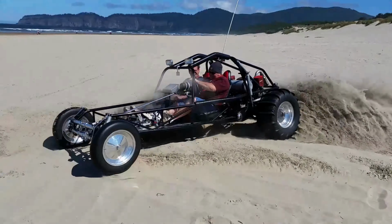All right, here's all the components to the master cylinder and power brake system. So basically cleaned all these up. Just removed the paint on this, put a little grease on the pivot here. This flushed it out. A little super clean on the lines here. That looks brand new. And then I did notice that there was a mark on this master cylinder that says 20. And this one says 23. So definitely verified that.